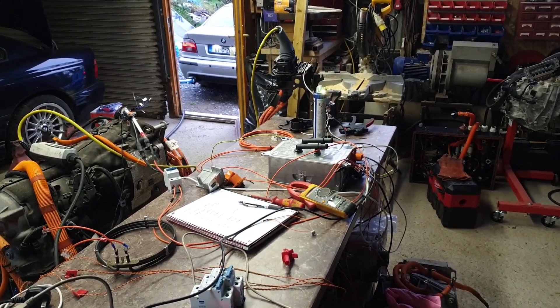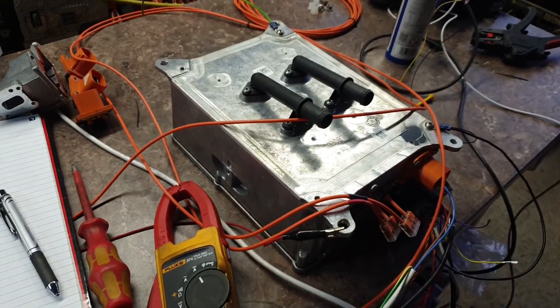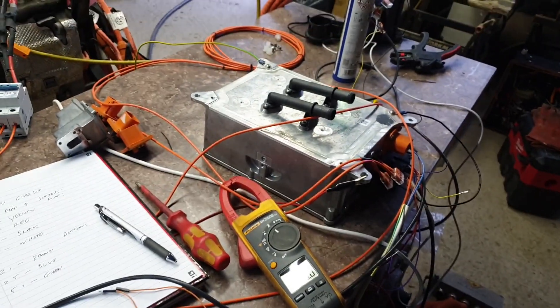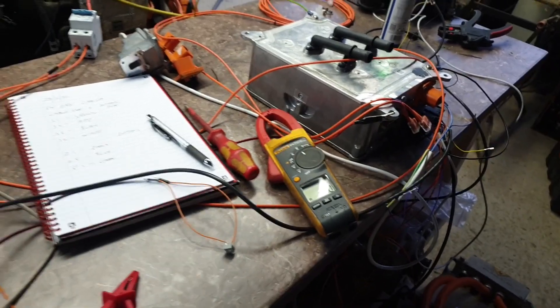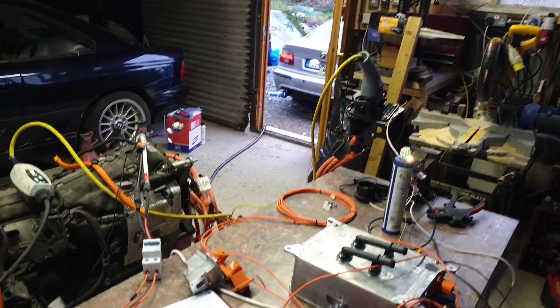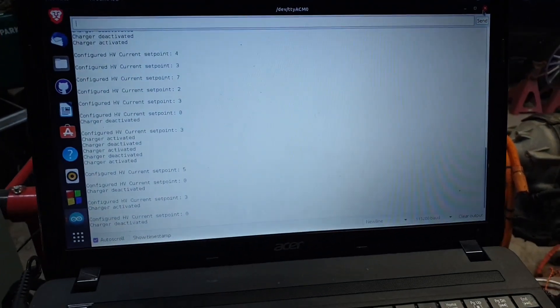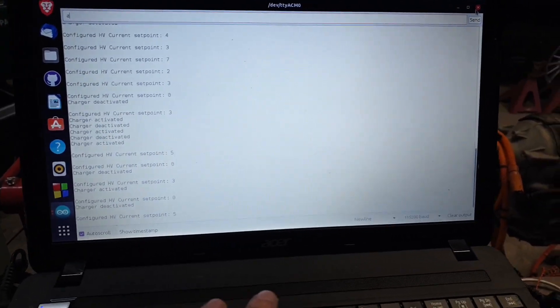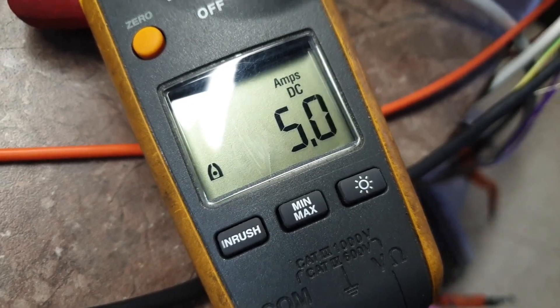Hello folks and welcome. We're back at our VW charger with a nice orange LED here, which is what it's supposed to be doing. We're hooked up to the land yacht with the CHAdeMO port — the yacht's at about 390 volts. Coming in here to the breaker, into the charger, we've got an ammeter on the charger. I'm going to come over to the computer and set my current to five amps. The charger now gets a nice green LED and we get five amps.